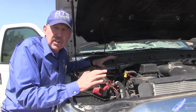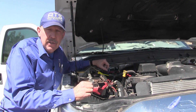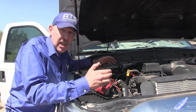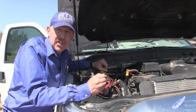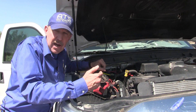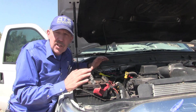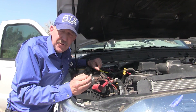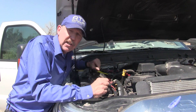If it's not in the driveline, it proves that this car is setting up a resonant frequency in the frame and suspension, and then we'll have to figure out what to do with that. Basically, each test's data is going to drive the next test. We're going to put a vibration sensor on the driver's seat and monitor the vibration against the CKP sensor. We know it's not a tire and not any rotational shaft — we're just confirming the driveline isn't causing this.